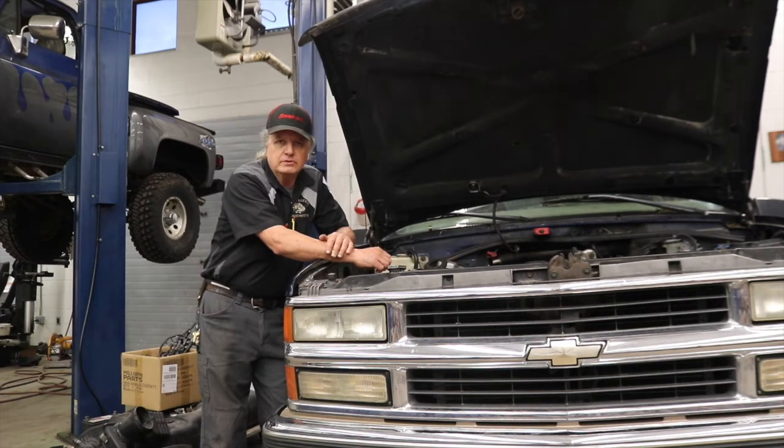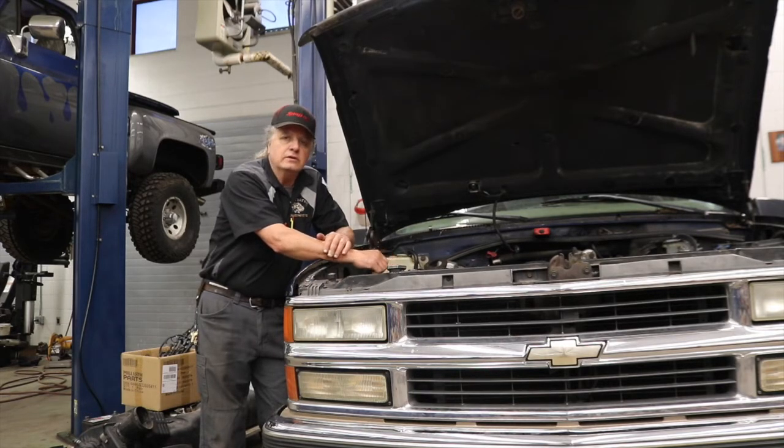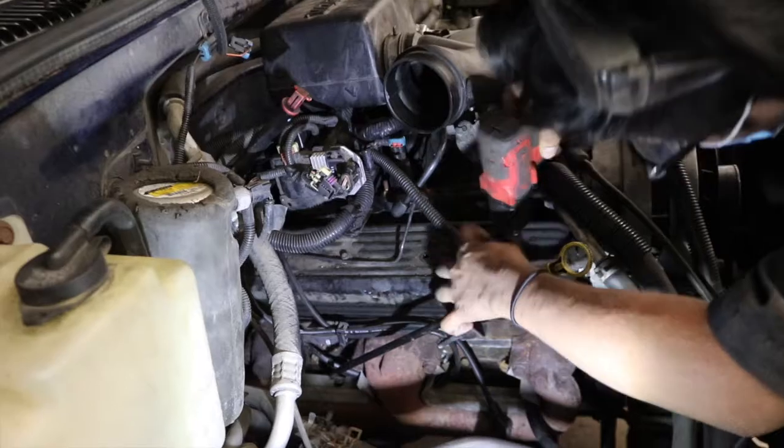So our next step was to do a cylinder leakage test on that cylinder, which you've seen us do before, to determine where the leakage was. By doing that, we introduced compressed air into that cylinder while it's on compression stroke and see how much leakage we have and where it is. On this particular engine in cylinder 2, we had 100% leakage, and it was coming from the exhaust. So you're going to see the students pull this apart and see what they found.